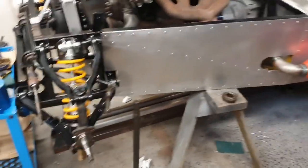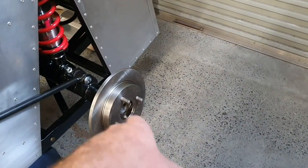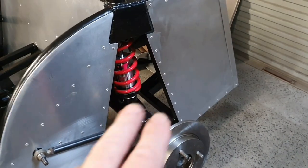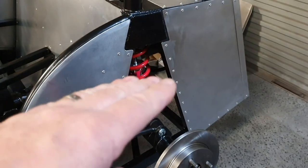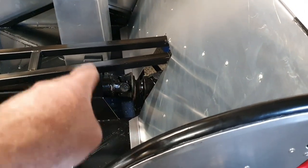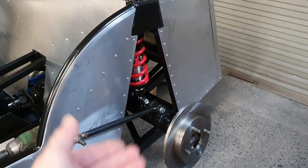It's not ready at all — not far away though. Put some hub on here, some roundy thingies, and the big one with the black stuff around it. We've got the shock absorbers in the back with some temporary springs — probably too strong, but they'll fit and help us roll it around. We need to adjust the bump stop because the droop travel is a bit far. If you look at the flanges on the drive shaft, we'd actually crash the drive shaft into itself — that's no good. But the top mount and a bump stop under the axle to limit droop travel — that's easy.